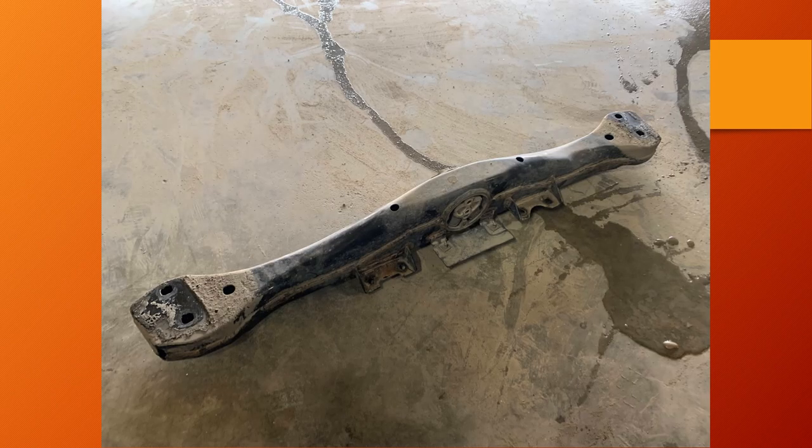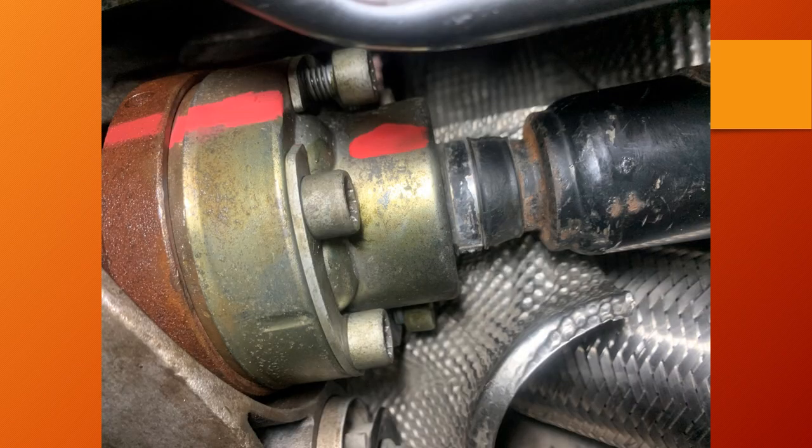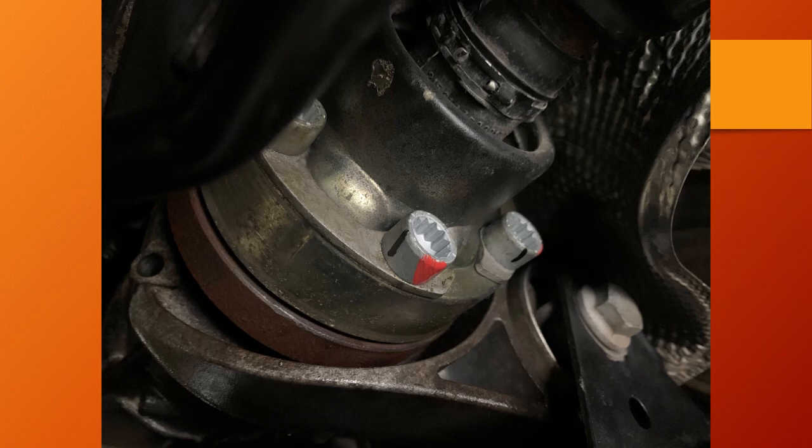Place whatever you're using to support the transmission back under it, then put the front drive shaft in place ensuring correct end to correct end and lining up the paint marks. Use the original bolt to pre-seat both ends and then one by one replace and torque them. The torque sequence for the front drive shaft bolts on both ends is two-stage: initial tightening to 22 foot-pounds on all six bolts marked with a sharpie, then an additional 90 degrees indicated with a paint pen. Don't forget you need a helper on the brake when rotating the driveshaft.